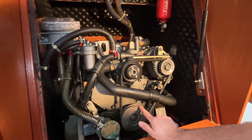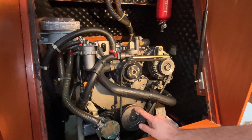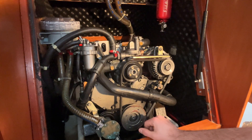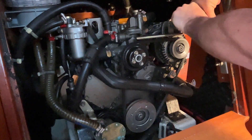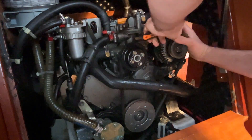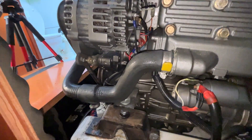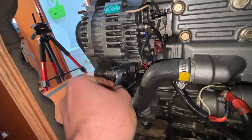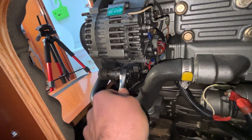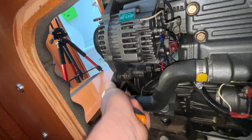I'm also going to remove all of the rust off this belt pulley and coat it in a rust-protective coating, a similar dark metallic grey to the engine itself, just to tidy up the engine bay. We're just going to loosen this top one here as well. There's a little access panel in the back bedroom and we need to access this bolt — it's a 12mm, so 2mm bigger than the others — and loosening that will allow the alternator to slide out and give some slack.